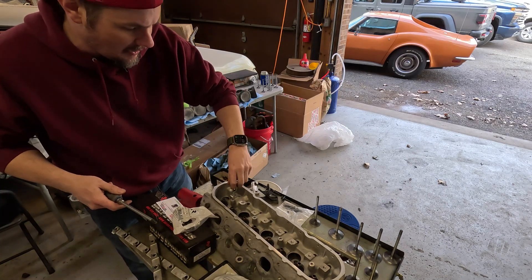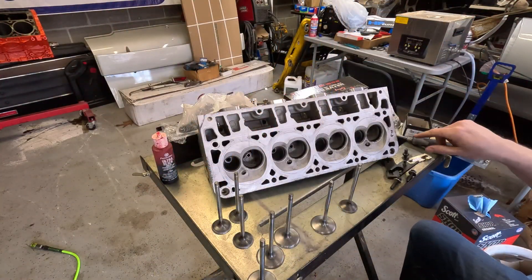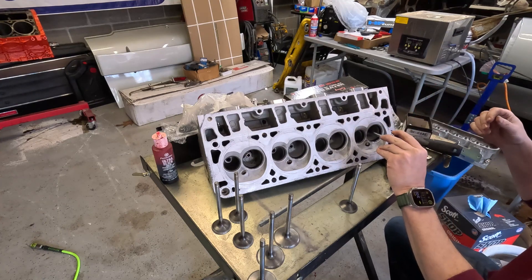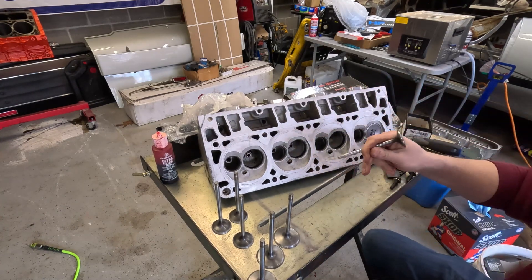This is going to make sure that we don't have any leaks when it's all said and done, and we're not going to damage anything in the process. If you watched my valve lapping guide, you noticed that I marked it — this is head number two, starting with this spot as number one. All my valves are numbered so I'm getting each valve back into the seat that it was lapped in.